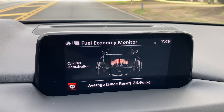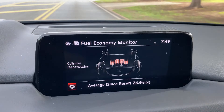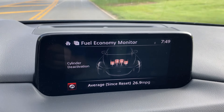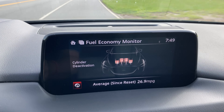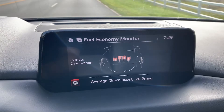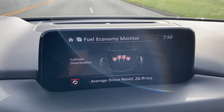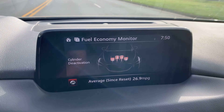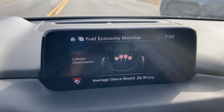I'm back on manual control since I just made a stop, now on a slightly higher speed limit road. One reason it keeps in two-cylinder mode so much is when you're above 53 miles per hour — with hills and different things, as the car slows down and speeds back up due to weight and friction, it was often in two-cylinder mode. I did not yet get to the 27 I was hoping for. I'm going to adjust cruise control to 60 miles per hour now, and in the next couple of minutes we'll see if we can jump to that 27 miles per gallon with the help of cruise control and cylinder deactivation technology.